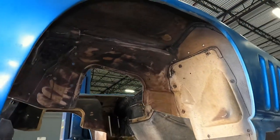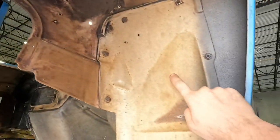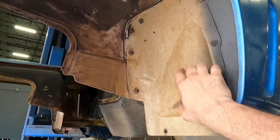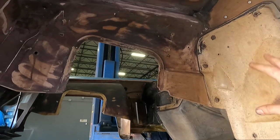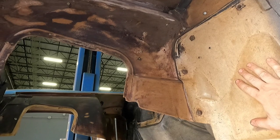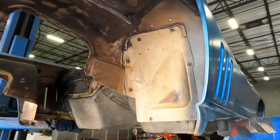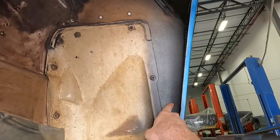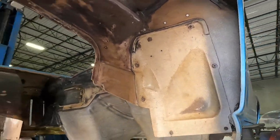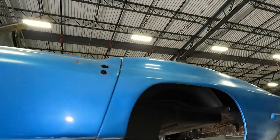You can see the wheel wells — we pretty much strip them down like this. You want it to feel smooth; you don't necessarily have to get it down to absolute bare glass to refinish it with the 3M rock guard product. You just want to make sure it is good and clean before you apply the product so it can grab. You can see how I started to line the inside here — I ran out of product in my gun so I'll have to make another batch, but it really comes out nice. This is the after.